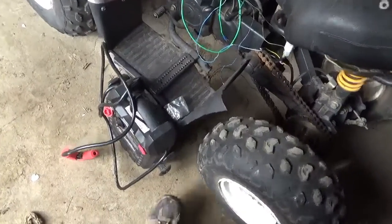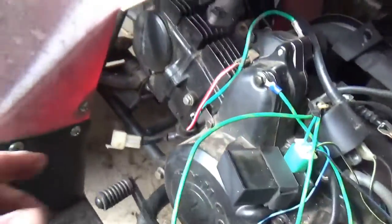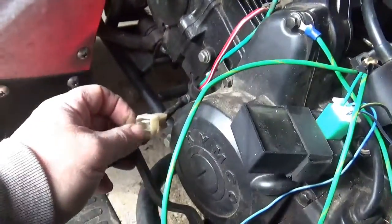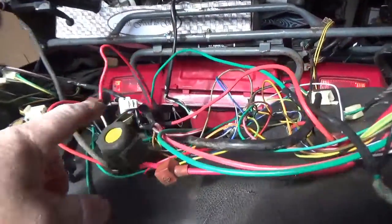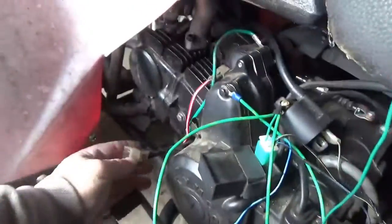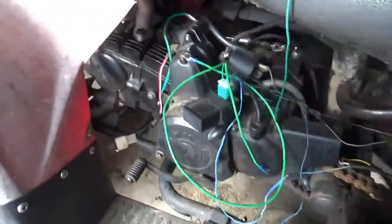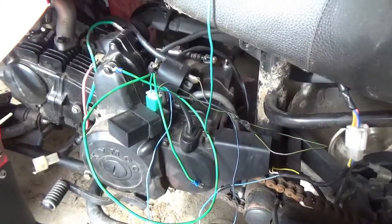What do we need to do this? I'm going to use the jump pack as a battery, and I'm going to use that push button as a switch. We have the wire harness here — I'd rather not cut wires — so I'm going to look through this mess, come up with a starting solenoid, and hopefully find the jack that plugs into it. Then we're going to hack it together and see if we can create a starting circuit.